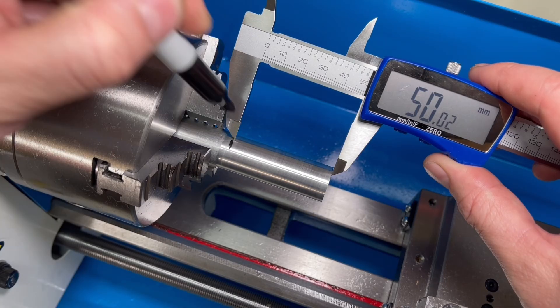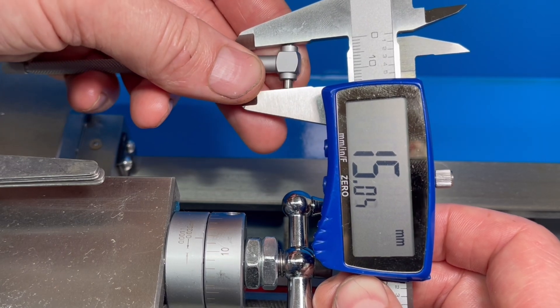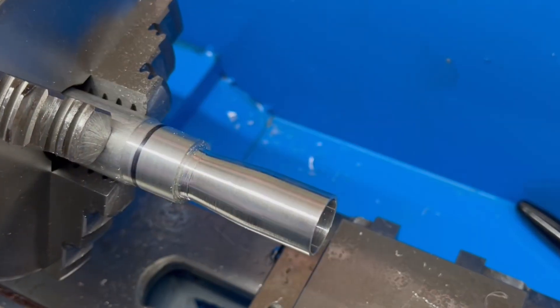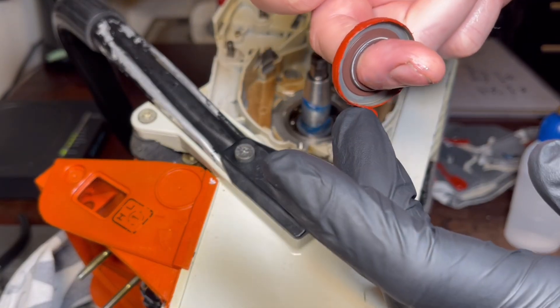It does require a couple of steps internally and also the right taper, but I'll see if I can make it out of aluminium because it's really easy to machine. As a recap: the first thing we do is clean that crankshaft where the seal is going to register against, then apply grease to both the seal and ideally the crankshaft as well. These seals are most often either nitrile or viton — both resistant to petroleum — so they don't require a specialised rubber grease. It's also a good idea to apply a small amount of sealant to the outside circumference of the seal. If the pocket it registers against is damaged — maybe there's a small amount of mag rot, or it's been scratched or chipped — that can also cause an air leak, so the sealant on the outside gives you a little bit of insurance.